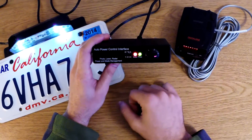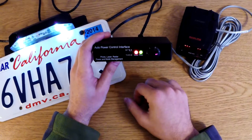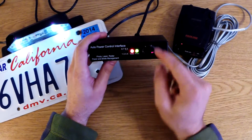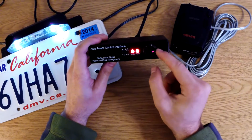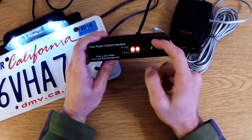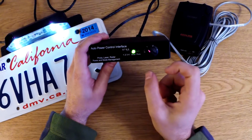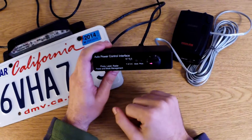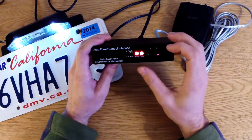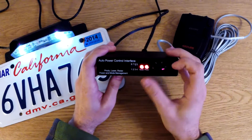With the 905s, the way you JTK is — and this is kind of annoying, I'll show you this in a second — you switch from position three to two, like that. And this switches from jamming mode to receiving mode. With your jammers, this is going to be parking sensor mode but no laser response. And this is full system off. So that's how you would actually JTK when you're using this in the field.